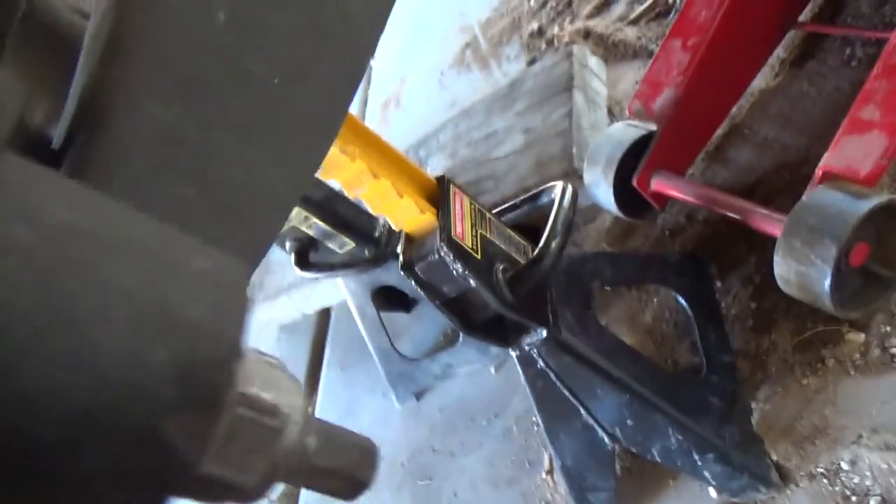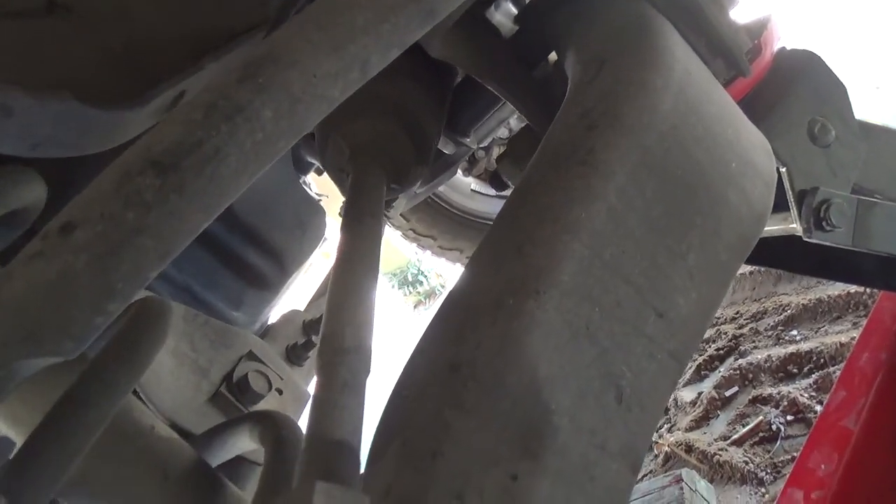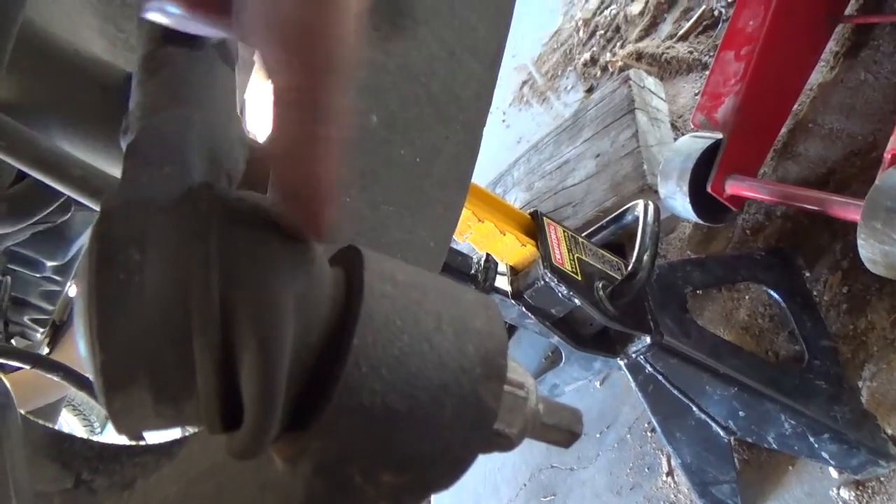This top bushing — this one was good. This one right here from the steering, from the rack and pinion or the steering wheel, this one I did like two and a half turns — it was a little loose.